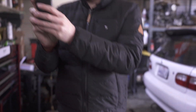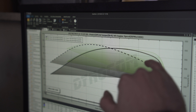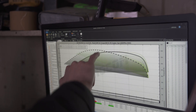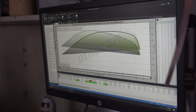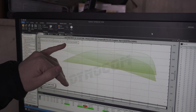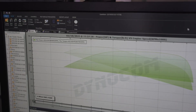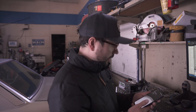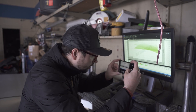Over 400 foot-pounds! Perfect — right where I took the timing back out, just like you said. You're going to see how it built from the first run and then carried. The boost comes on hard. On the final run we leveled the power back out, got the power back — lost a little peak then gained it back — and got more torque, which came in with more boost. Final horsepower was 385, and over 400 torque. Killer.